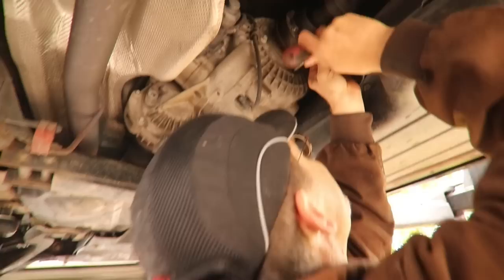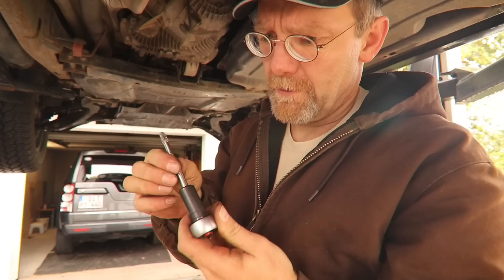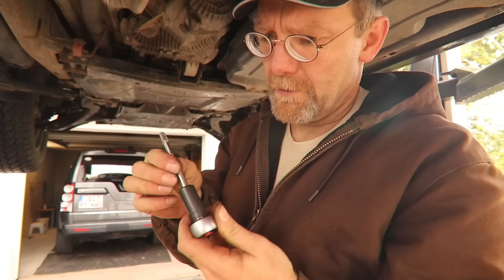So, Christian's gonna cut a thread in there. Yeah, that's what people do. Just to mount the camera. If some oil is coming out, it's too deep. This is an adapter where you can mount regular taps onto a 3/8 ratchet. I got that for all tap sizes. Cool, what a nice tool. And it even got an O-ring in it so it doesn't fall out.